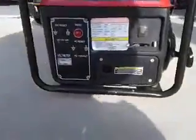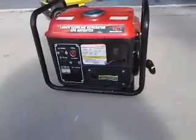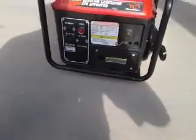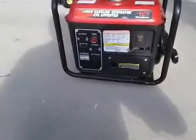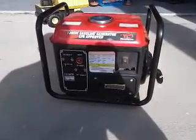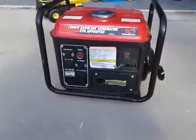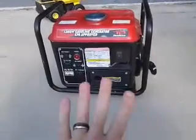After that, you pull this. It'll take a few times for your initial start — meaning the very first virgin start, not after you've gotten it going for about an hour. After an hour you don't have an issue with this, but for the first start just get it going and run it for about an hour. I changed the spark plug when it first came because that's what people told me, but I put the original back in and it wasn't the spark plug — it just needs to be primed and broken in. That's it for the initial setup.